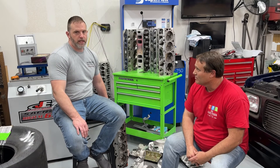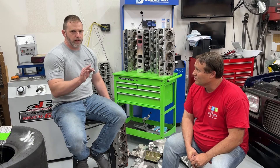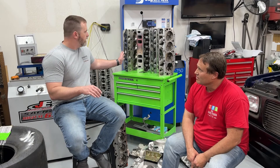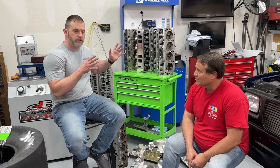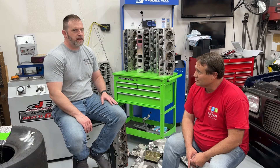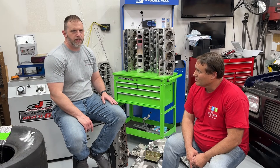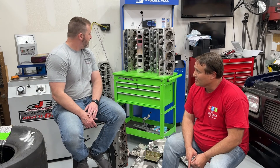My guess — I like looking like a fool, people watch me for that — I think the 049s are going to be the worst with no spot where they're better than anything else. I think the ProMax 290 is going to win. Not because they gave me the heads for free — if you look at the flow numbers, the best is the 317, then the 290s, but the 290s also have the smallest chambers and highest compression ratio. I think that combination is going to be the winner and have the best average power too.